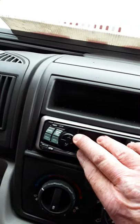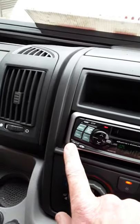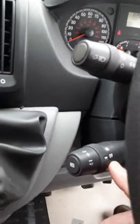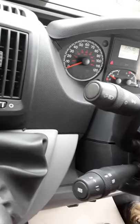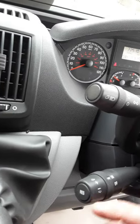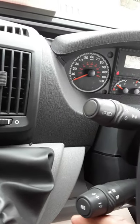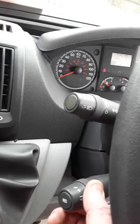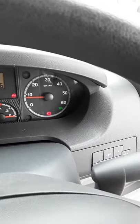Your stereo just clips in and out — when you're not using the van just press the button and clip out the front of the screen to save the stereo from draining the battery. You also have cruise control here — turn that on when you're driving and give it one shot up and your cruise control will come on. You can speed the van up and down with it and there's a resume button on the side. A little green light in the corner shows when your cruise control is on.